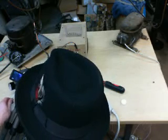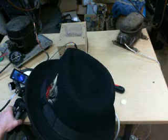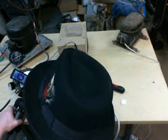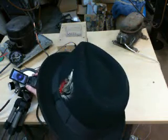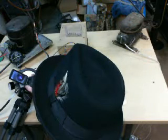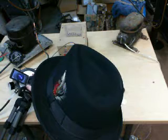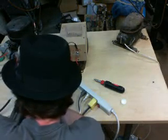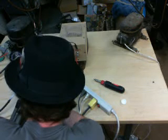So I'm gonna bring that back down to about right in here. That looks pretty cool looking. That looks real cool right there. It's about 27 to 28 whenever it looked really cool there. And let's bring it back down. Watch it again. 26, 27, 28, sorry about the camera work, that's right about 29 vacuum right now, that's inches of mercury. So there you go, that's what it looks like.